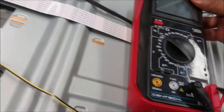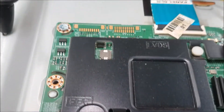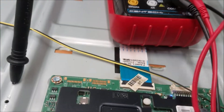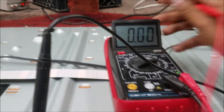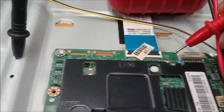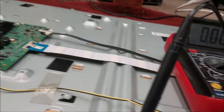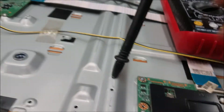This is a very important voltage for the TV picture — this voltage here and this fuse. We put the multimeter in voltage mode and test this fuse: we have 12 volts on this side, and 12 volts on the other side of the fuse. So there is power going to the T-con, but we still have no picture. Let's do another test.